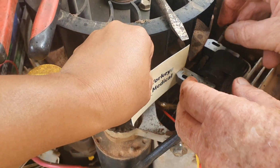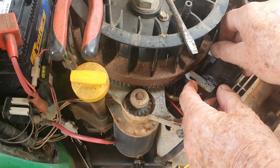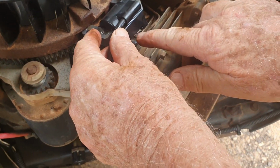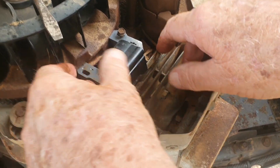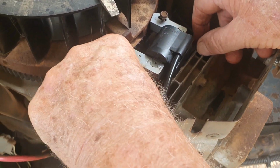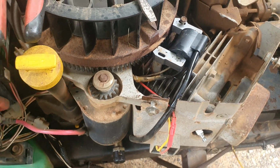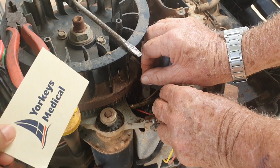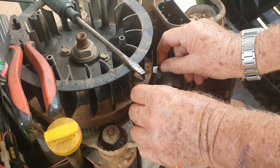Yeah, because they said you need to have that. That's right, but no, you're missing my point. The switch there, it's not insulated. It's so close to the fin there. If that shorts out, the engine stops. Or if you had a bit of wet grass or something there. So maybe that's the cause why it's stopping. Well, it does stop, so therefore.